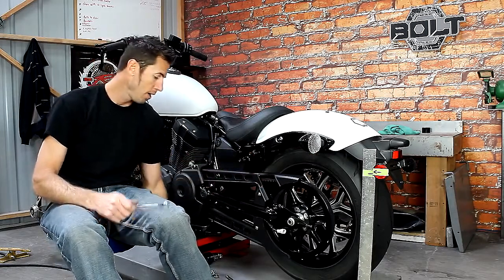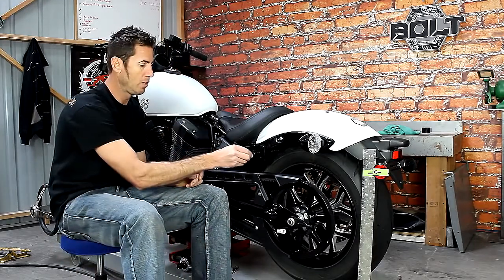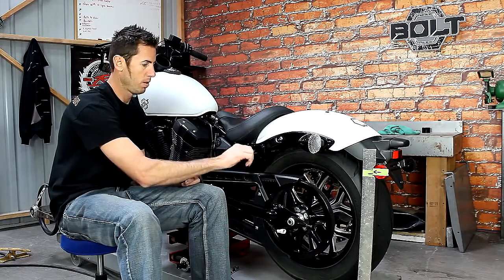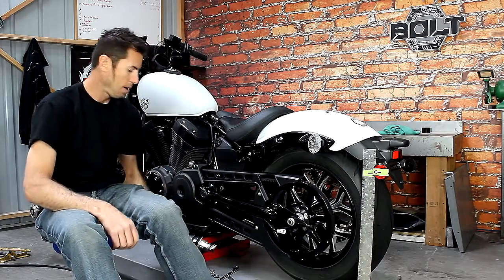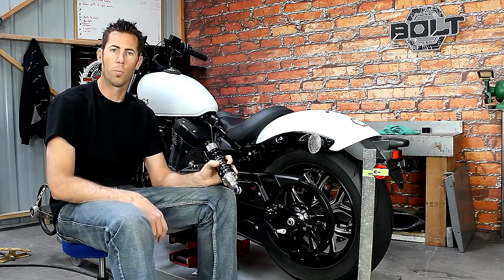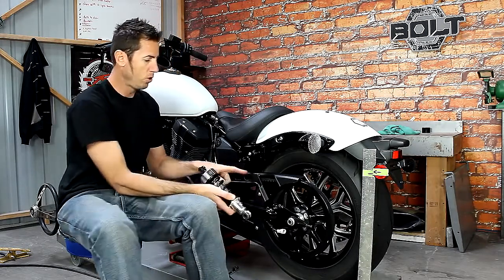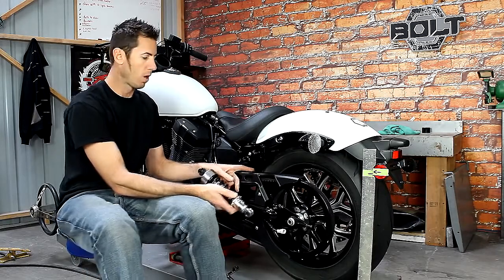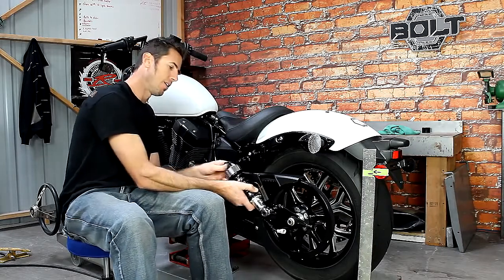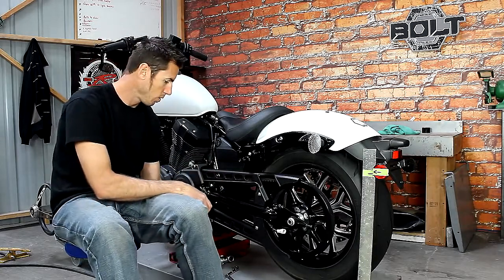The original mount is really not being used, but we do provide a little button head bolt which you can just twist in there to fill the hole. The next step is to install your stock shock. Now this bike has just the normal shocks — it can go on the original way, but with the new position you are going to have to remove your stock belt guard, as it is in the way and the new position won't allow you to use a stock belt guard.